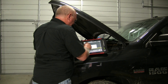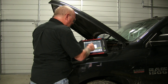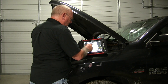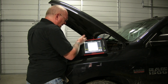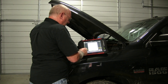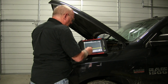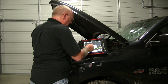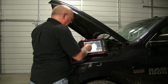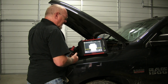I'm going to stick with the four-channel scope setup and set up the first trace on channel one. I already have it set to a 2-volt range — that's the total range on the scope, nothing fancy in the other menu items, so I'm good there. Then we'll go to setup and take a look at the sweep time — right now it's set for a total sweep of 200 milliseconds across the screen, and I think I'm good with that.